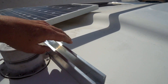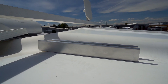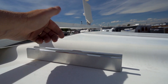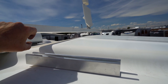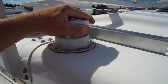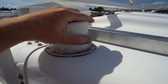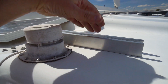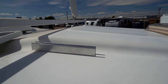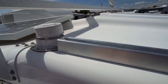This vent is in the way, but as you can see the raised area in the back is taller than in the front, so the solar panel will sit up higher — the Unistrut will sit the same but the bracket will extend up a little taller to attach to the panel and hold it higher in the back. I'm going to take the vent cover off here since the solar panel will actually cover the vent and the cover would interfere with the panel. The opposite side of the camper will be just a mirror image except there is no vent, so that Unistrut piece will come all the way out to the edge.